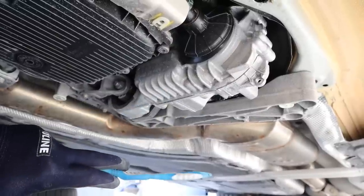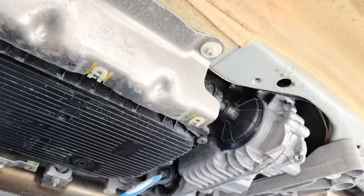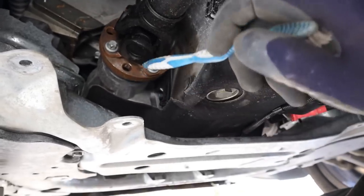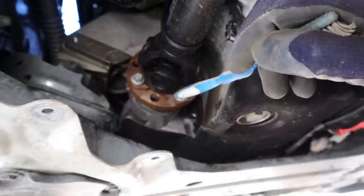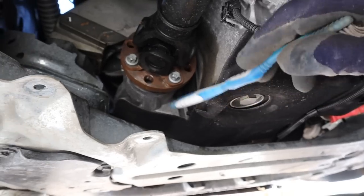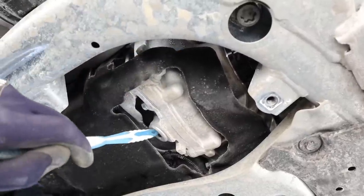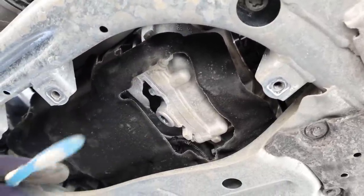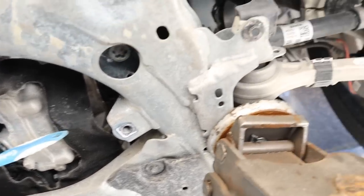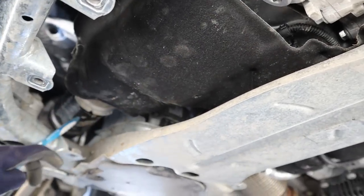This is primarily a rear-wheel drive vehicle but it does have a transfer case that feeds the X-Drive all-wheel drive system, with a prop shaft leading to the front wheels. That prop shaft goes into the front differential, which has axles going out to each wheel. Because of its position it has to pass through the oil pan to the passenger side, and goes directly out for the driver's side. The front differential has its own fluid with both a fill and drain port, and it's integrated into the oil pan.